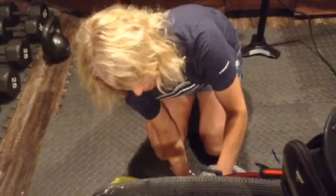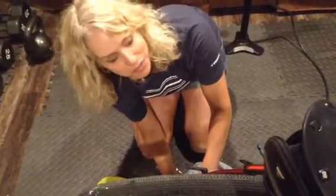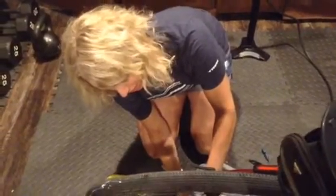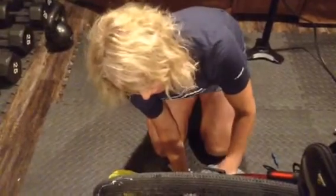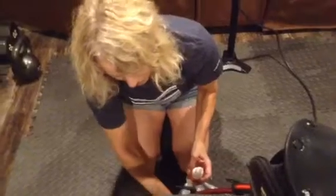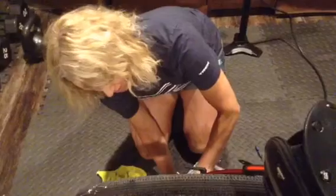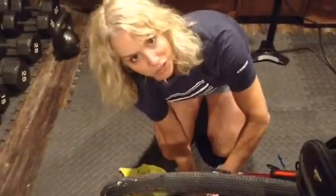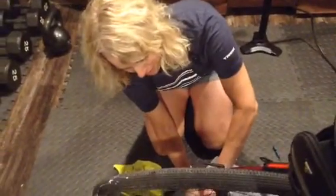And then depending on how you ride, there are different types of sealant. Mountain biking has a little bit stronger sealants that you can get. I like Stan's. I've used Bontrager as well. It is also good, if your bike's been sitting for a while, to put some new fluid in there before you start your season. Because if it dries up, then you will have to take your tire off, get the old dry gunk out, and put in some new one.